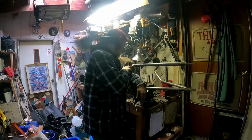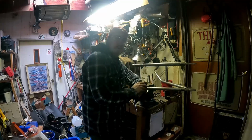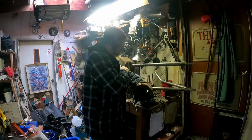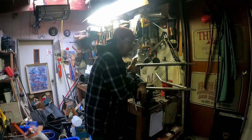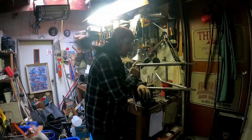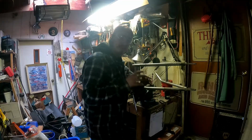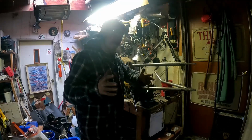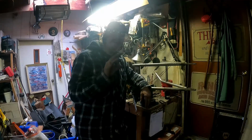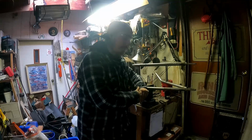So the next step I have to work on is getting these original slugs out of my hardtail kit, because they're too narrow to fit into my original frame. So I'm going to use this time to help extract them, figure out the inner diameter of this DOM piping, and make custom two-step slugs, 1 inch down to this diameter, so we can actually make a solid, full-filled enclosure. I'm not a mechanic or a machinist or engineer, so I don't know any terminologies, but it's going to fill up the entire gap on the inside diameter of both this portion of the frame and my main frame.